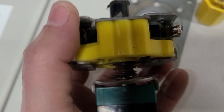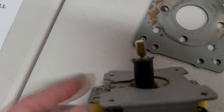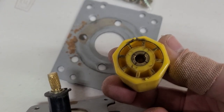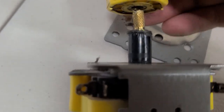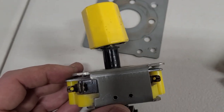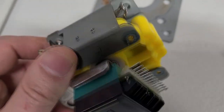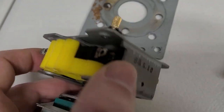Here is the problem — here's the one that I've removed. I've disassembled it pretty far, I've got all the parts here, and the issue is that it was bent. You can see how far it's actually bent. That means that the actual joystick — in order to remove this, you have to 3D print a little thing that removes the clips on it. It's super weird. Jesse printed that for me, so thank you, Jesse Gadget Psycho. I tried straightening it a little bit but couldn't get it quite right, so I decided to take it apart and remove it and straighten it that way. If I can't straighten it, maybe I can replace it with something — I think it's just a shaft that goes down. In order to remove it, I have to remove this snap ring, and I don't have the right tool, so I've got to order that.